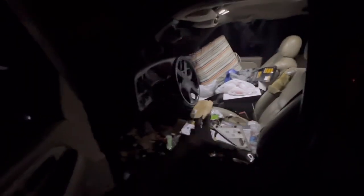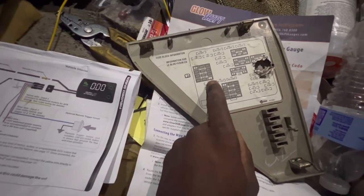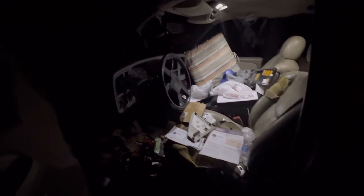Guys, don't mind the mess — it's literally two in the morning. We finally got our gauges wired up. For my constant power I put it on the TBC 15-amp fuse, and for my switched power I put it on the ignition zero to 10-amp fuse. That was fairly easy. I could have used the orange wire especially for the GlowShift gauges — that's for the headlights so when you turn them on it would dim the control module brightness.